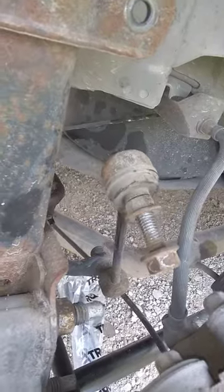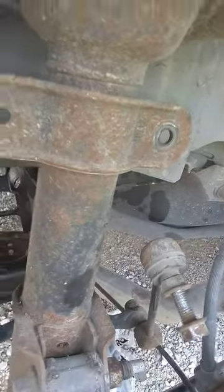So you got a 13-16 bolt right here, and then you got the head over here on that side. To make it easier so you can get to them two bolts right there, which is kind of by the gas tank, you're going to have to drop this whole rear end right here. It's holding on by two bolts — you got a bolt there, bolt there, and it's vice versa. I took off the sway bar link too, so it can make it easier to drop.